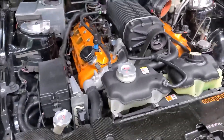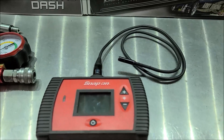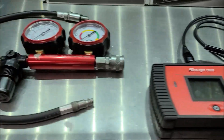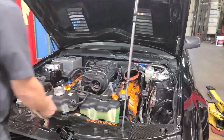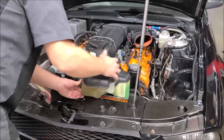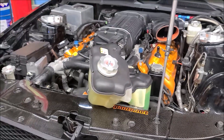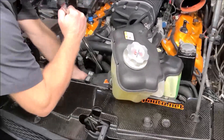So we're going to go ahead and finish the leak down test. What we have here is a camera we can look down into a cylinder so we can verify that all the valves are opening and closing properly, and of course do our leak down test. We're going to move the coolant tank out of the way so we can get to the crankshaft bolt and put a ratchet down there so we can spin the engine over.